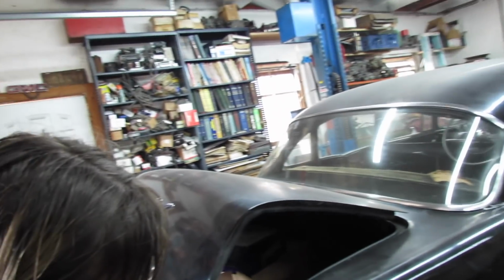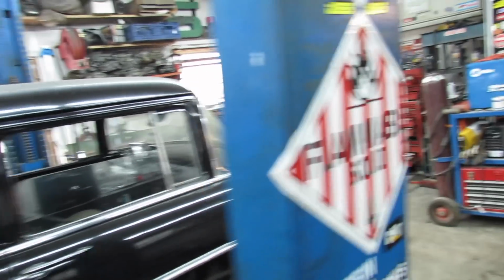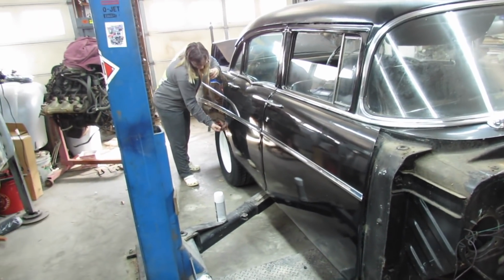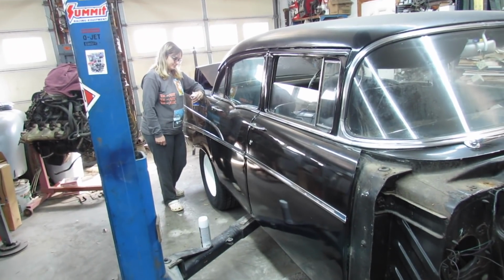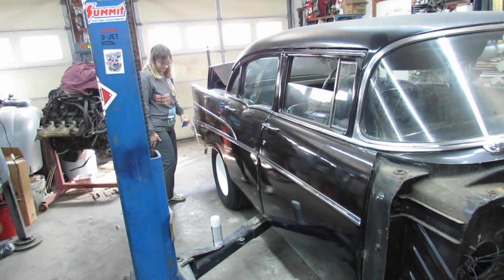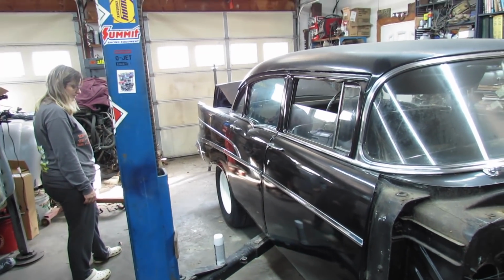As soon as I get front tires on, I'm pushing it out. You got another thing coming. Spent too much money to do that. Wow, yeah. We can probably get it out with a little hammer and dolly work. But a 275 60 15 will fit with an 8.8 out of an Explorer. 8-inch wide wheels, 4 1/4 backspace. I think they look good.